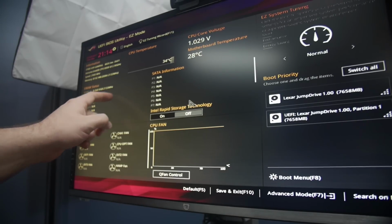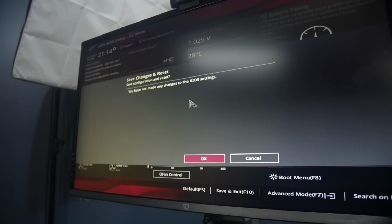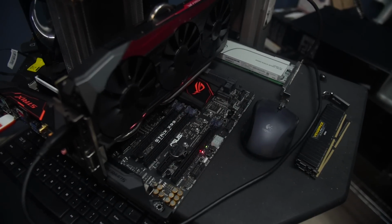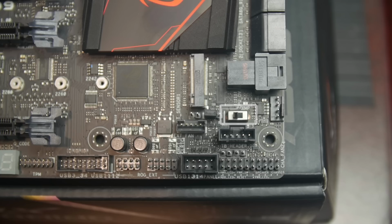So normally you have to go into UEFI and toggle a setting, and that will work. But in this case, Asus has said, well, some people are intimidated by that. Let's just give them a physical switch. So you throw the switch, you get a light that comes on, and then bam, your memory is going to run at 3200 or whatever the XMP profile is. Now you can still change it in UEFI. You can still sort of reset the machine. Like if you're troubleshooting, you can still put it back to the default speed. But this physical switch lets you toggle between the two things.